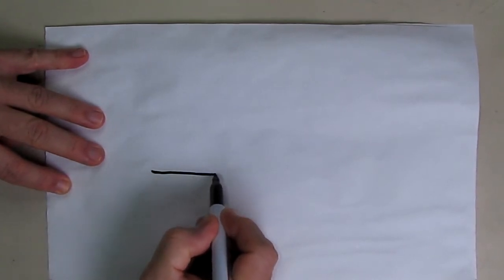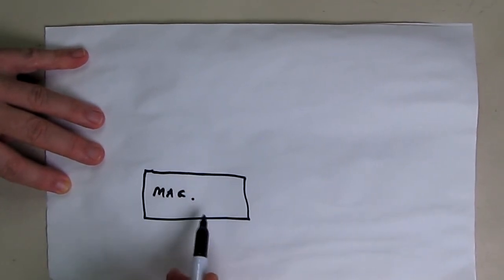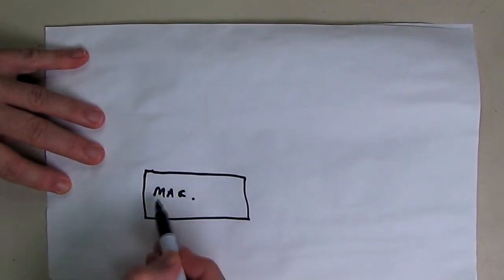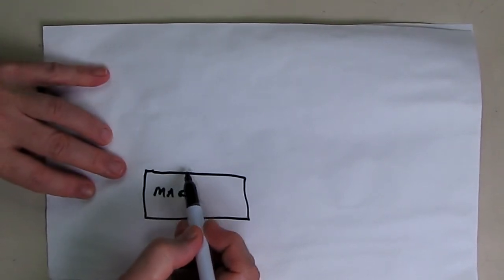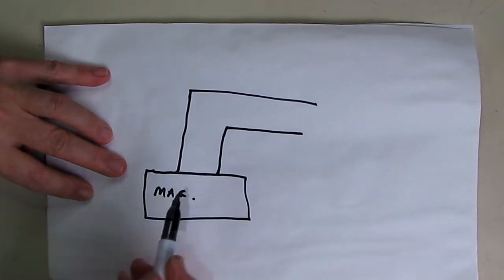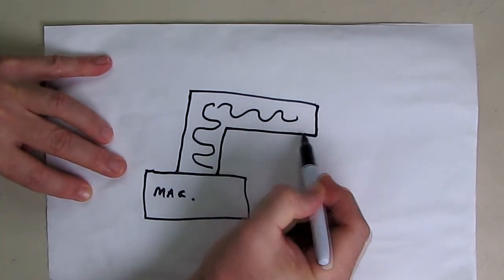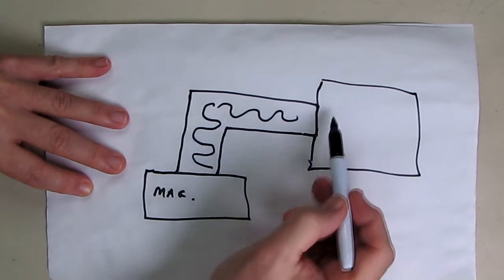Now, on your microwave oven, and these are all microwave ovens, there is a piece of electronics that's called the magnetron. And this magnetron generates very high frequencies, microwave frequencies. Now they don't leave like a sound, like a speaker or like an antenna. They're so high frequency that they propagate out in something called a waveguide. And this is essentially a tube, a rectangular tube that is designed to have these microwave energies travel down them very rapidly. They have to exit somewhere. So they exit where you see that opening in your microwave. There's your microwave right here. So that is where they exit.